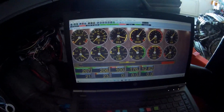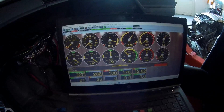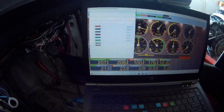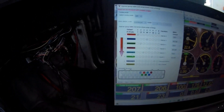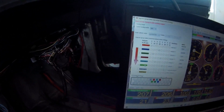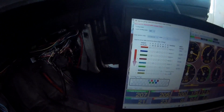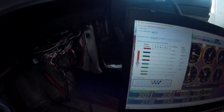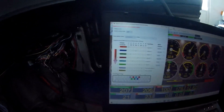That's how the primary trigger works. Also nice to show is the injector settings — injector outputs. I have eight outputs, with six injectors per bank. I have them paired by two, so six pairs total, and all outputs are selected. I'm using one injector output channel for the fuel pump and the last one will be used for my cam sensor, which isn't in place yet because I don't know the RPM range — that will be done on the dyno.